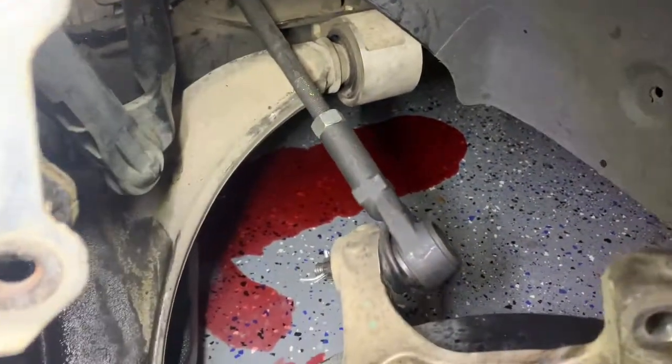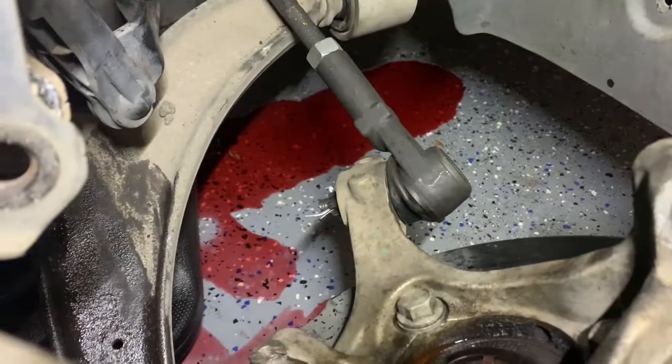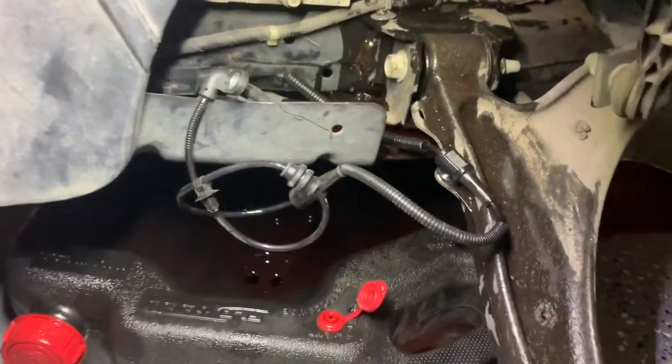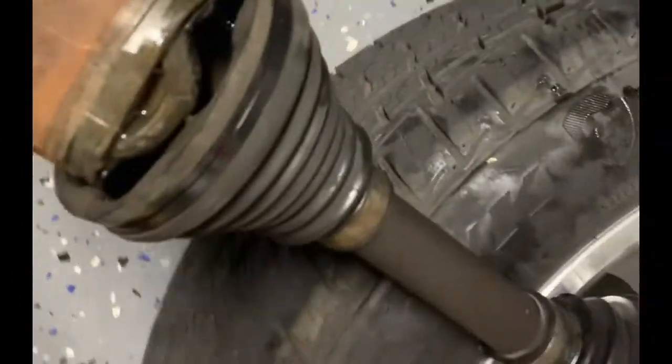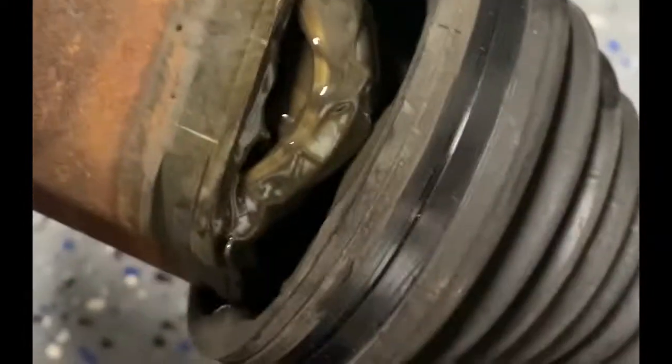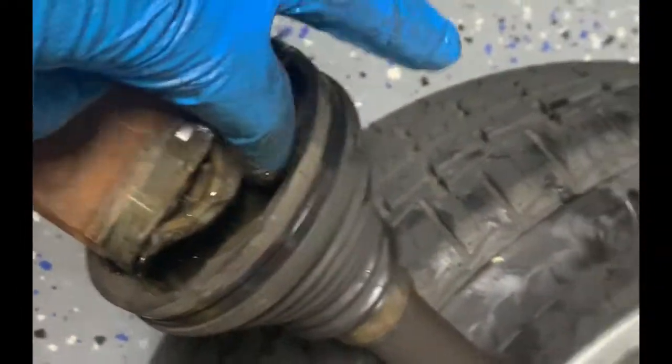There's a pretty significant amount of transmission fluid leaking, so we can see our transmission fluid is very good — all red, didn't see any metallic particles, so that's a positive. I took my old CV axle, took off the clamp holding the boot, pushed this back — it's covered with grease which is a good thing — and it's not rusty, so there's no moisture getting in.